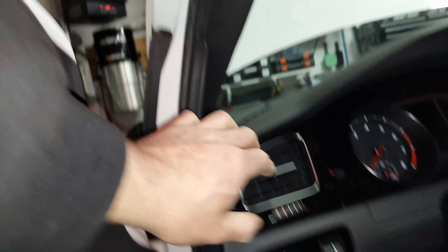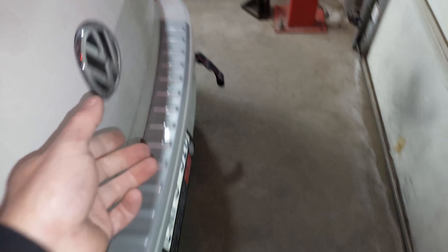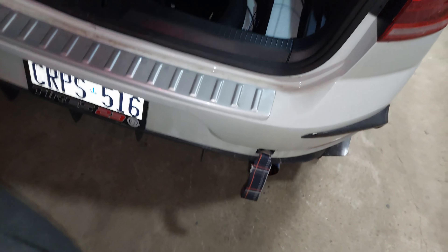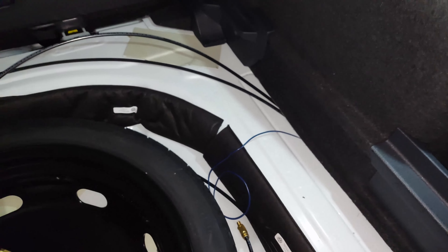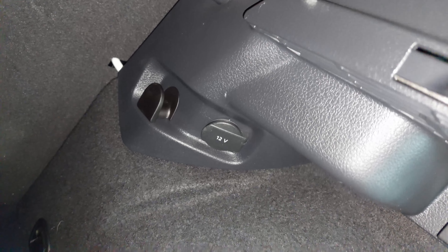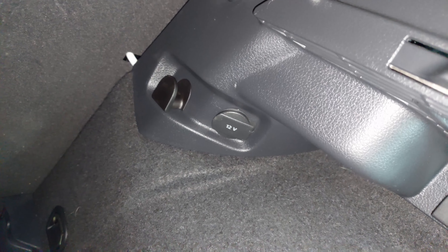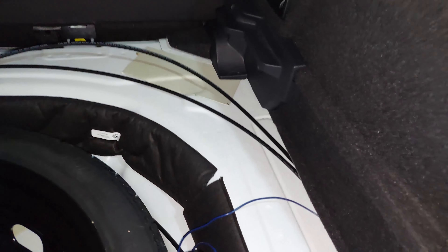I think I'm going to place the controller up here, or maybe in the center — I haven't decided yet. I took the 12 volts from the cigarette lighter right here. I tapped into the positive and checked it — it is remote-on when you turn the ignition key, so it's ACC-enabled, which is perfect to start up the management. You don't have to run it all the way from the fuse box. I ran a tap into it with a 3-amp fuse to protect that circuit.